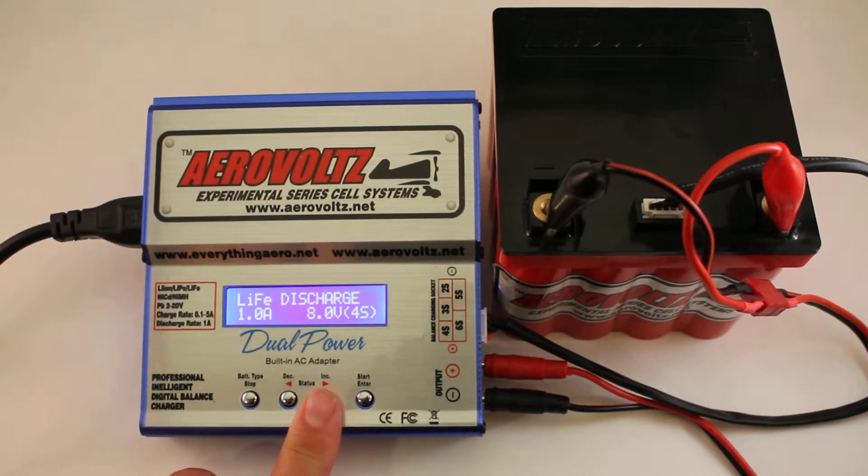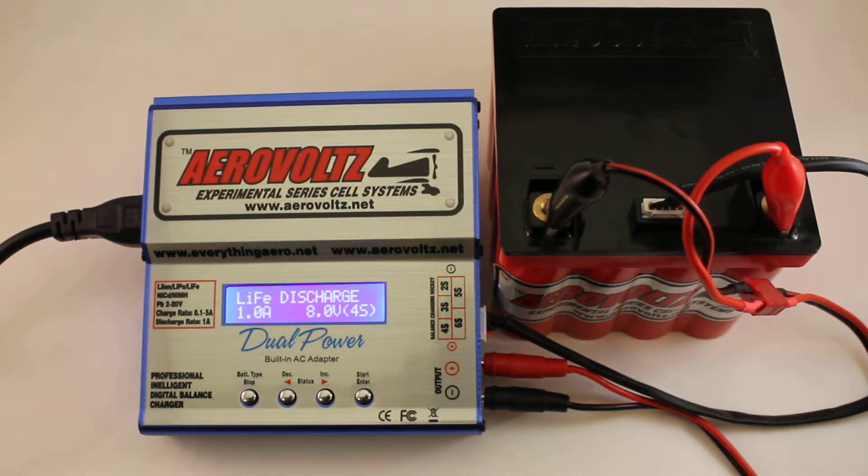Now we're going to talk about discharge. If you've got a battery where the cell pack is dramatically out of sequence — from doing a lot of work with the avionics, running your flaps up and down, testing electronics, autopilot, things like that — where you might have drawn that battery down below 10 volts multiple times and charged it back up with a regular battery charger or your airplane, you could get the cells out of sync. Sometimes you have to do a discharge with the charger, which will balance as it's taking it down as well. It'll help bleed those cells off to get them back in sync and try to get the cell packs closer together.